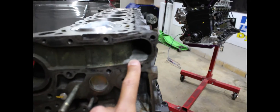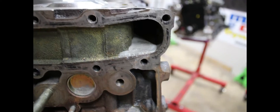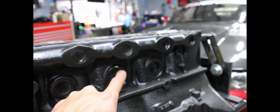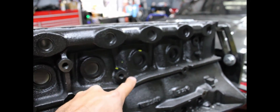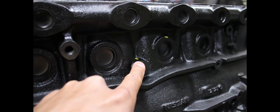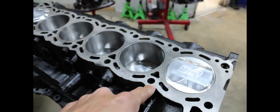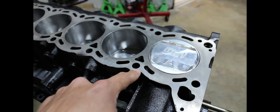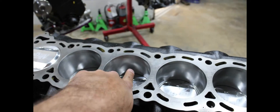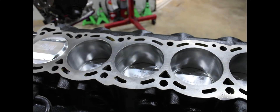The solution is simple — this is a block half-filled with grout. So that is our grout line, represented by this little yellow marker here. All of this in the block is filled with grout. Because of that, this crack physically can't happen because it is completely sealed from the inside. You have now added more meat to where the hardware bites, which takes off a lot of strain from the deck. The typical common area where the bore breaks is usually towards the bottom because that's where it's thinnest — the grout actually keeps that from happening.